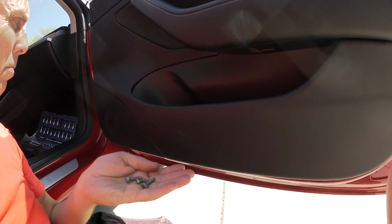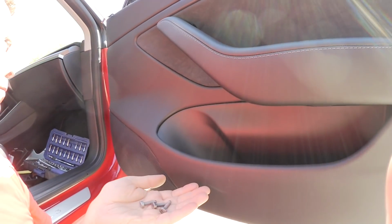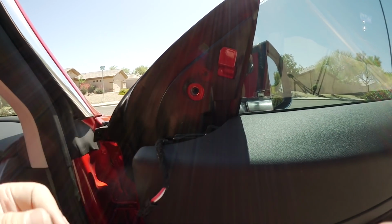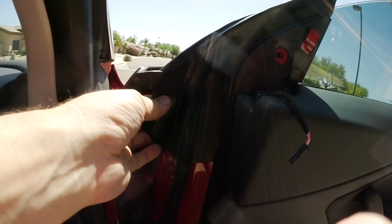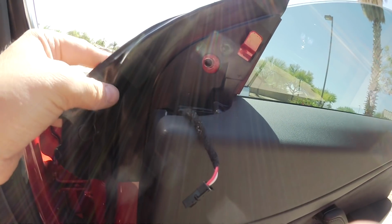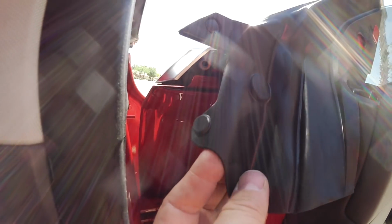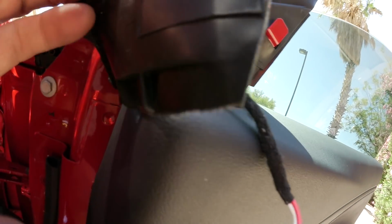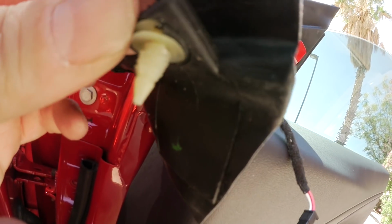So now the next thing is to pry the whole door cover off the door. Next, I took that bolt out, just an M10, 10 millimeter bolt. Then you remove the rubber plugs: one is here, the other one is here on top of that bolt, and the other one is here on the side. And then you can access the other M10 bolt, and there is a third one, probably underneath the door. When you remove the rubbers, watch out for those little plastic pins so that they don't slide out, especially the one in the middle of this one. And then you can access the bolt here.